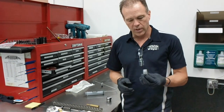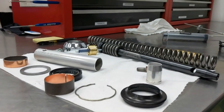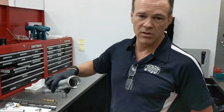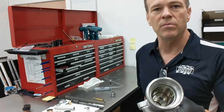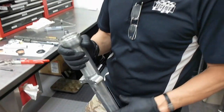You'll find in the bottom of your fork a little cone — that's going to be down in the bottom of the leg, it'll just fall out. All these parts have to be cleaned now. I can't stress the cleanliness enough. With your contact cleaner, you're going to spray down into the tube vigorously. You're going to find a lot of mud and gook and sludge down in there. When you look down in it, hopefully you see it's just as clean as a whistle. Clean the bore where the seal's going to sit — we want that to be no corrosion, clean and very smooth for when we drive in the new seals.